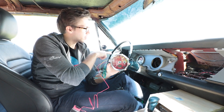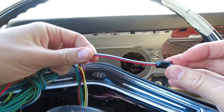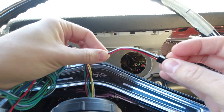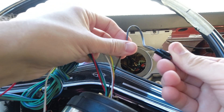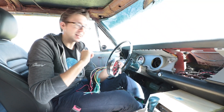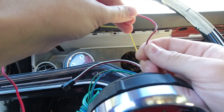Ready to start wiring this in. I've already got a head start because our inverter for the backlighting is already installed on the other gauge. At first glance it seems like the most basic connection, but it's going to get a little tricky. This has your 12-volt ignition, ground, and dash light sense for the actual backlighting of the gauge. It lights up the dial, and you need to have this hooked up to the inverter — we've already got one installed and it has a second output from the other gauge, so that'll just be a simple matter of plugging it in.